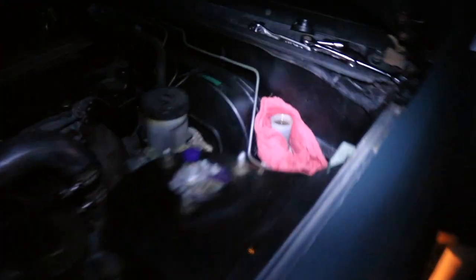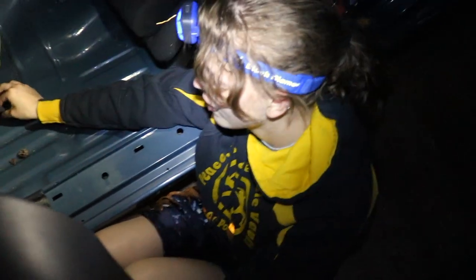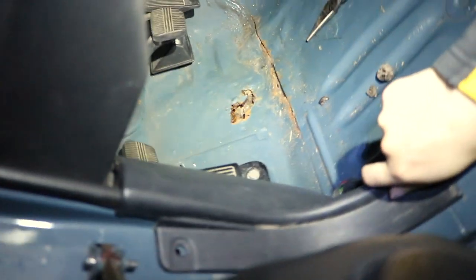Things are looking pretty well for the Teal 240's clutch system. I have Desiree's help pushing the clutch pedal. We got briefly distracted by what turned out to be walnuts stuffed in the engine bay — looks like a squirrel was living between the firewall and the damper box at some point. Anyway, what I have Desiree do is pump the clutch pedal in about eight times and then hold it at the bottom. By doing so the fluid fills in the lines, and then I go under and bleed the valve. All right Desiree, go ahead and pump it.